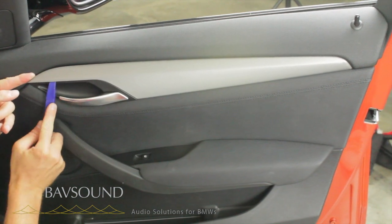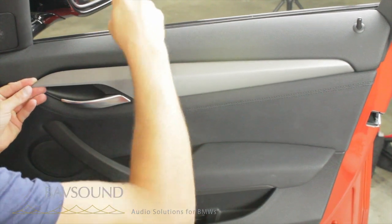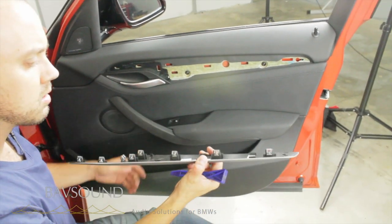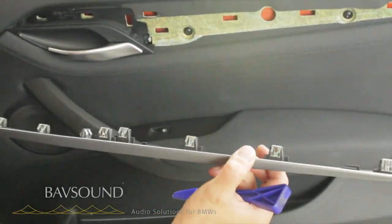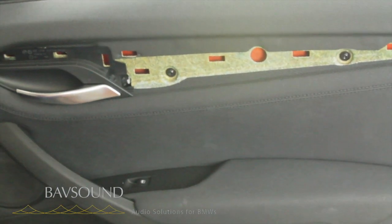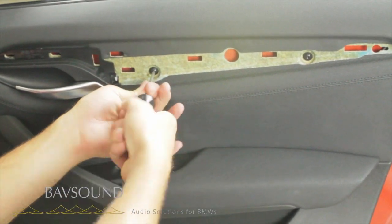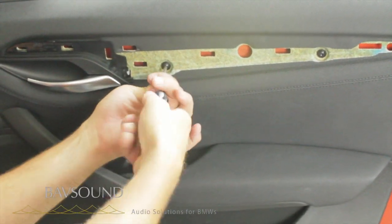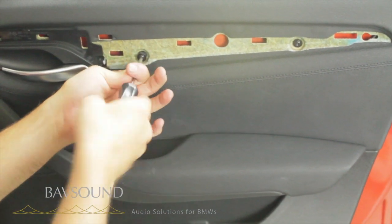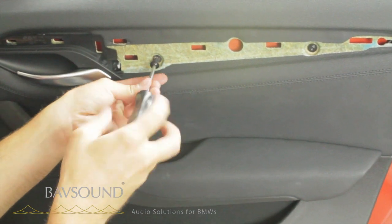This is a brand new car, so your car is going to be very similar. One, two — these little clips, super nice. So if your car comes with carbon fibre or those dinosaur eggs and you want another color, it's super easy to swap out. Now that reveals one, two Torx T20s, both of which need removing. To do that, you turn the screw to the left. Please note: if you just learned that right now, please have this professionally done at your local BMW center.